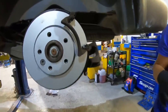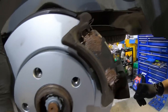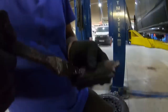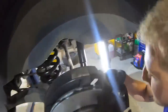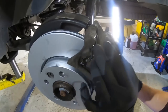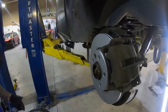Right, stick that one in there - get that in there. Both pads are in there nicely. They slot back in like that. There's no sensor on this one - that just goes over there, and then we'll put the two bolts back through. The piston wind-back tool is quite handy - you can't do it without it really. I've seen people try to use screwdrivers but it's not good. Get the right tools for the right job.